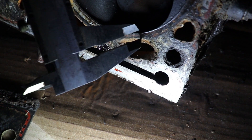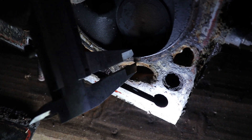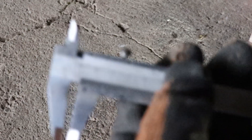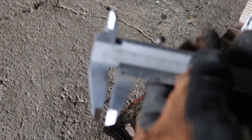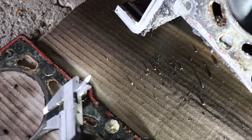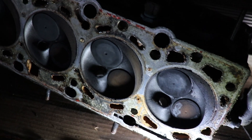The surface — the contact surface of the head with the gasket — is over here, and it is less than four millimeters. I didn't measure that correctly earlier which is why I'm moving the measuring tool, but it was less than four millimeters wide. This means that even the metal part that is on the gasket is wider than this contact surface, and so this head is not going to do the trick.